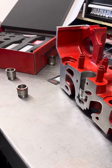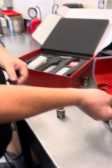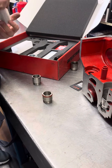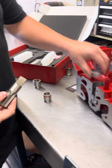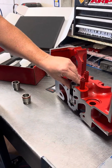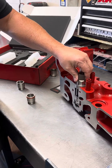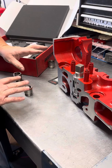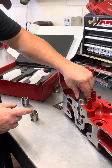Once you've got that done, you start with your guide ring that slides right down into here and your first tap. The instructions explain which tap to start with. That guide ring fits in here nice and secure so that you can tap correctly. You spin this down and use the instructions to understand how deep and what to do with the tap. You tap that factory cup.